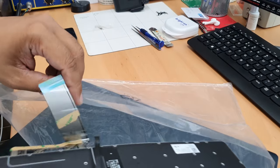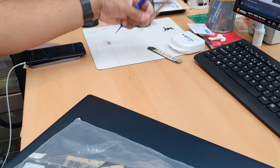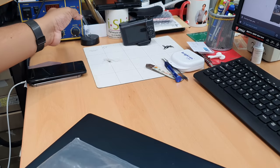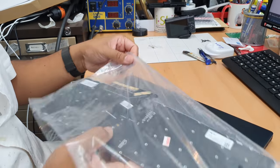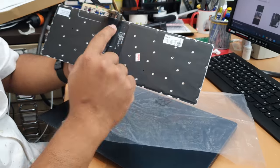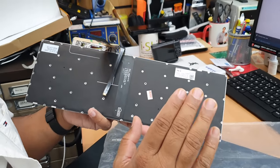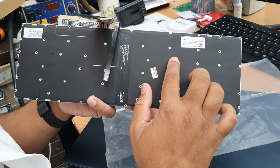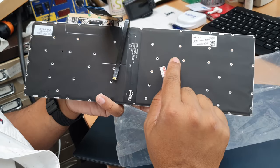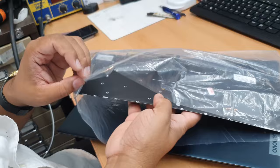You need a couple of tools. First, the Phillips screwdriver, which one is in here, then obviously the flat tool and the tweezers, plus I also have a soldering gun here if I need to melt something, because there are a lot of rivets that put the plastic on. Normally in MacBooks, 2013, 14, 15 and MacBook Pro, they put metallic rivets on it, but this one they put plastic. So we're going to check what kind of rivets they use to hold the keyboard.